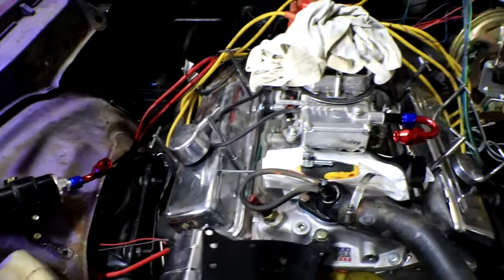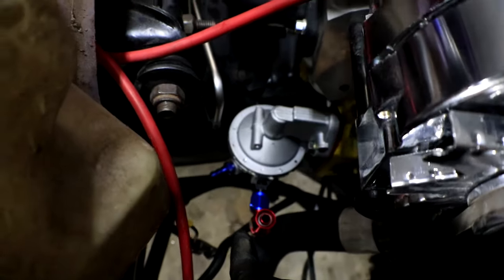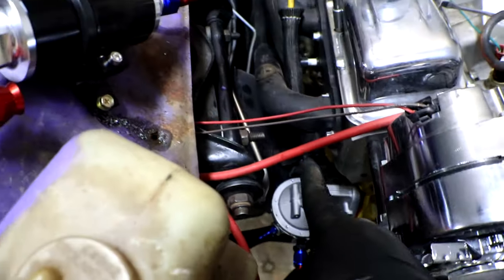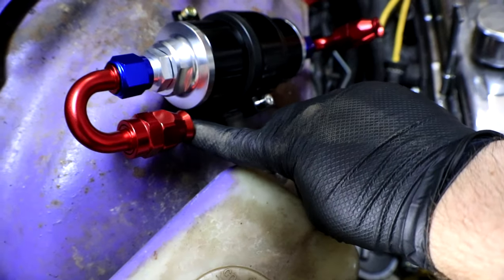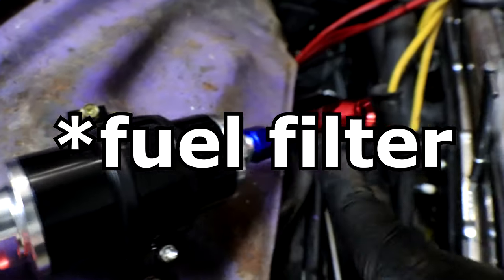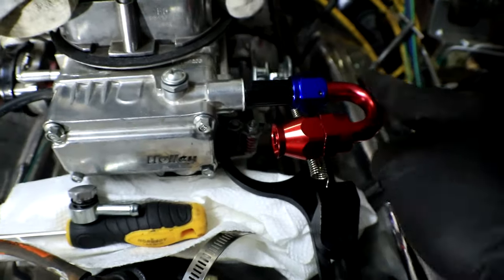All right, now that we've got all of our fittings in, I can show you exactly how this is gonna run. So going from the fuel pump all the way to the carburetor, it's gonna start right here at this fitting. Come up right through here, turn and loop straight into the fuel pump here. Then it's gonna come around through this U-turn, go through the fuel pump, out this 90 degree, from this 90 degree all the way over to here, through this U-turn, back into the carb, and then into the engine to create power. Now in theory, all I should have to do from here on out is cut the tube to the correct lengths, get it all crimped down onto our fittings, and then we've got a fuel system working again.